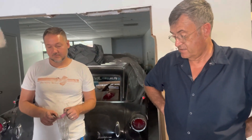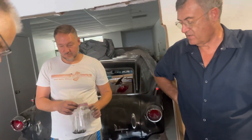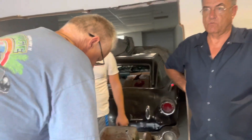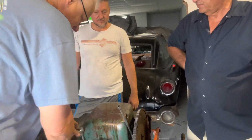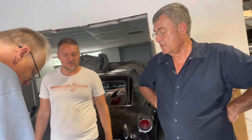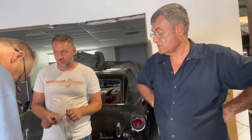The Oldsmobile V8 was designed to go up to 12 to 1 — well, they were designed for beyond that because of the safety factor; they were actually designed to work to it. But they were anticipating 12 to 1, and we never quite made it. These engines were built for up to 14 to 1 compression ratio, which is almost a diesel. Modern engines now will run 11 to 1 and manage pre-ignition with sophisticated electronics. That's why you'll get premium recommended — meaning you should run premium, but you don't get the full power unless you do.